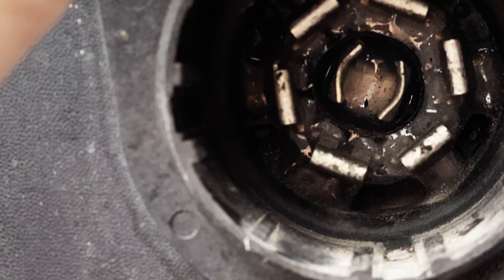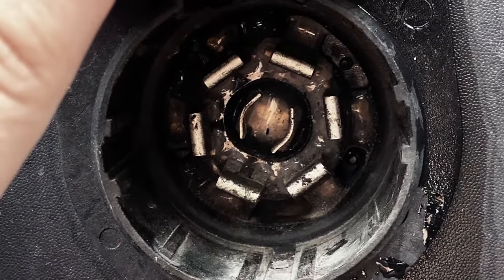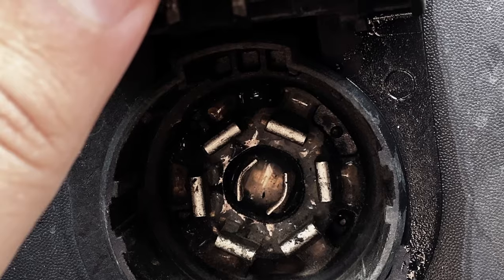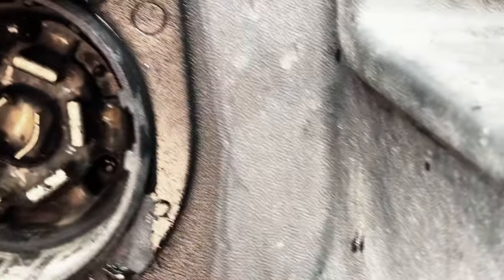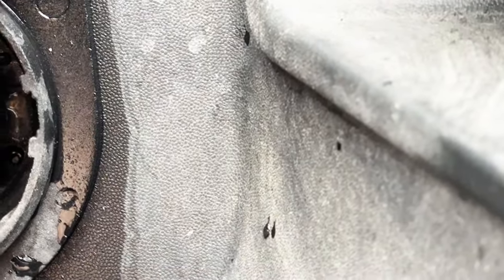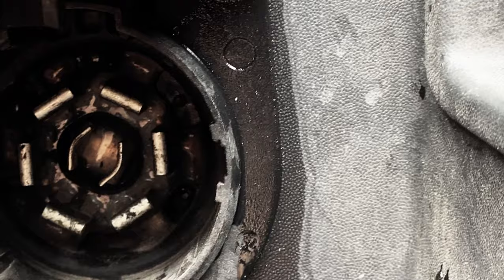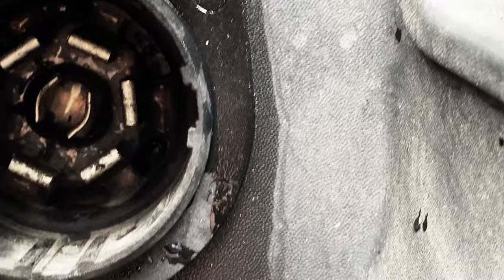You'll also get the rest of them if this constant is out. If that fuse is out, you'll still get all these because all these are different hots as well whenever you want them. Anywho, that's the problem I just ran into and had to fix. I hope it helps people who are looking for why their trailer battery keeps dying. I think it keeps going out because these trailers tend to leave their lights on inside, and that's probably a little too much power to send through that little wire this many feet back — that's a lot of resistance in the lines. So I imagine it's probably blowing that fuse not just because of the jack, but also because of all the power being requested constantly.